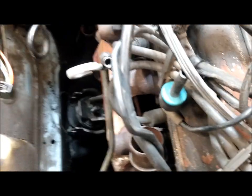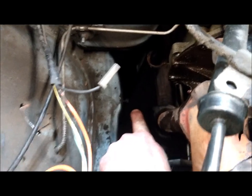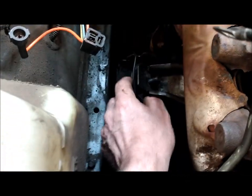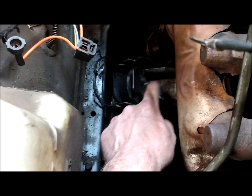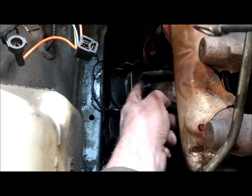Take off the ground cable — it has a ground point here — and flip that over onto the engine block heater if you have one. Flip the cable up on top. There's a positive cable that runs from the battery with a 10-millimeter bolt right here and one on top. Then there are 18-millimeter bolts on both sides for the mount. Flip back that safety wire that holds the engine, and take the 18-millimeter nut, locking washer, and washer off because they will get caught on the thread trying to get it out.